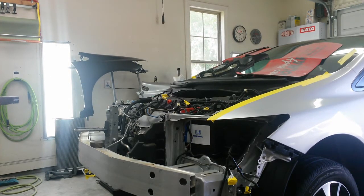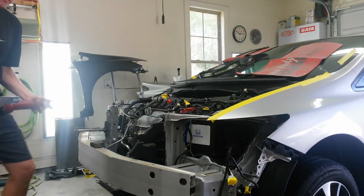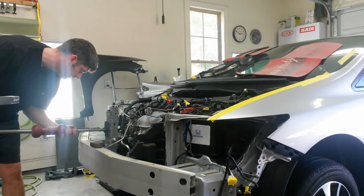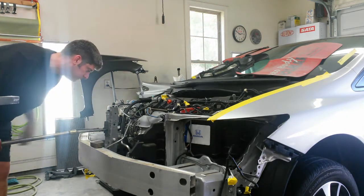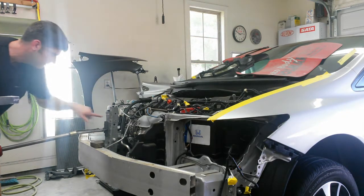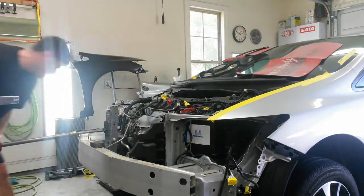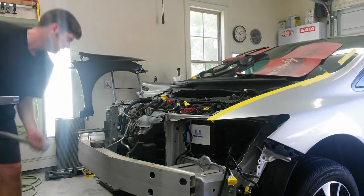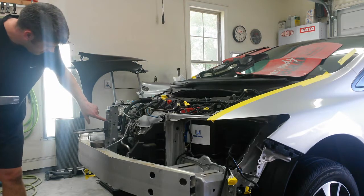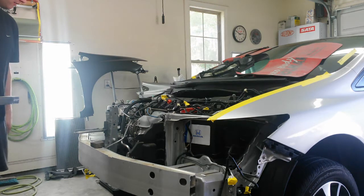Alright, I'm starting to pull that flange out to get the front face of that back straight out. Hook it on my vice grips with a slide hammer. It's going to pull the whole thing forward some, but I'm just going to have to work it back. I've got to pull this out. I'm going to have to work my way up, probably a couple places here. That spot looks good. You go up and do at least one more spot weld there. You've got to pinch it right where the spot weld is, where it's closed together.